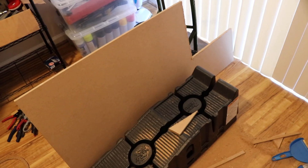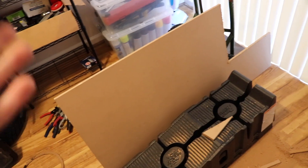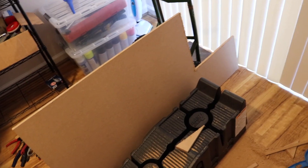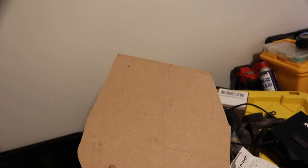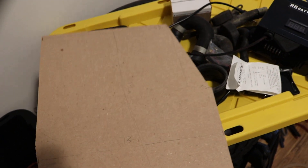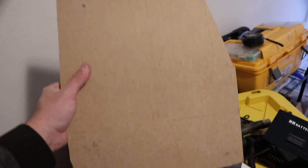It's a pretty nice open area where we can put a good sub. After you get everything cleared out, you can start measuring for your speaker frame. There are a bunch of different ways to do it, but I got some MDF board at my hardware store — this was the smallest I could get. I cut out a corner big enough to fit more than what was back there, slowly cutting it down and re-measuring, and this is what I came up with. It fits inside the hole back there so I can put it behind the frame and drill it in place.